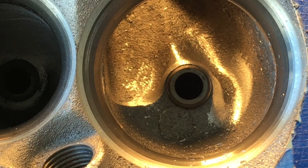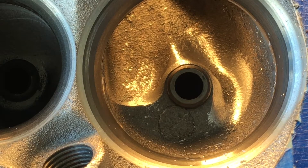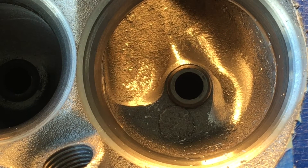Here's where we're starting today. I wanted to try to go over the removal of the swirl ramp on these cathedral port cylinder heads. This gives you a starting shot of where we left off yesterday with the initial shaping and guide boss reduction, where I worked it to where I want to get my quarter-inch double cut egg to fit down into that groove on the right-hand side.